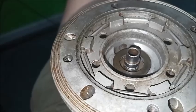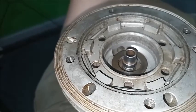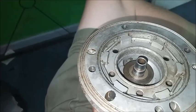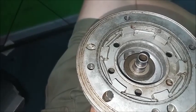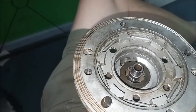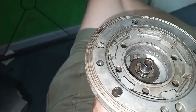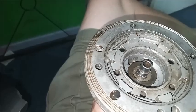Here it is again with the rubber ring on. Air valve is completely, brakes are completely released, so air is allowed through. And at this point, atmosphere and vacuum are both blocked. And now vacuum is allowed, holding neither, released atmosphere. And that's basically how it works. Released, applied, holding, released. Applied, holding, released.